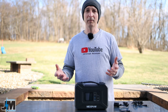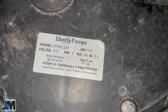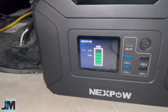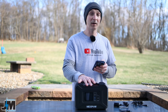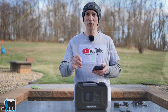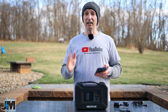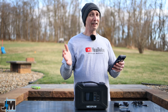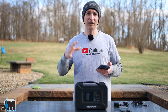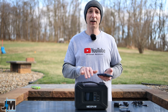One last test: I tried to run my Liberty pump one-third horsepower sump pump, rated at 5.2 amps at 115 volts — about 600 watts — though while running it was drawing about 465 watts. I had a feeling it wouldn't run it, but it actually kicked the pump on for about five seconds at 465 watts before shutting down. In my opinion that's pretty good, since this unit has a max output of 500 watts, which is likely just a peak. So keep in mind what you're running.